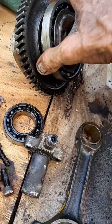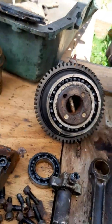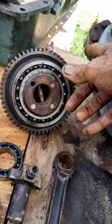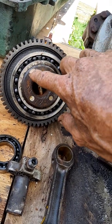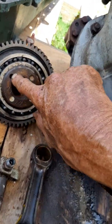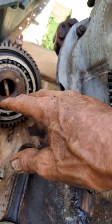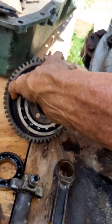The engine can be started from the front — a hand starter fits in here and protrudes out through the front cover, so you can hand-start it and take power from the crankshaft. But for my uses, I bolt a flange with a shaft here — it's already got the four tapped bolt holes — and you get a 4:1 reduction right there.